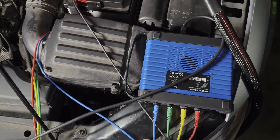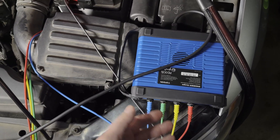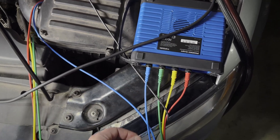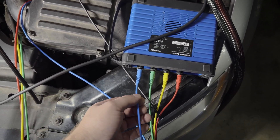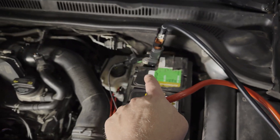That is a golden rule on a shared ground scope. There are other shared ground scopes besides the Topdon, but no matter what shared ground scope you're using, you need to always either ground one channel or put all of the grounds to the same place. We'll see you next time.